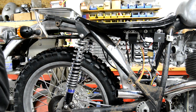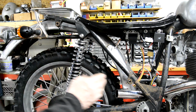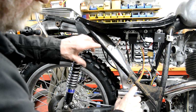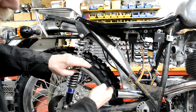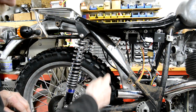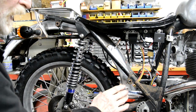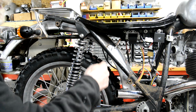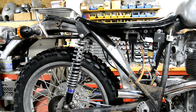I was looking at, there's a company here that makes exhausts for cars, they call them Dynaflow exhausts. And what they are is, where the exhaust goes in, they're sort of staggered baffles, so that the exhaust comes in and it has to go around them. So basically there's no restriction to the flow in effect, which is why they call them Dynaflow, but it does constantly deflect the path that the gases take. So I'm going to try that with this one.